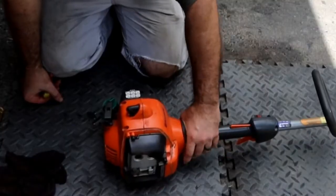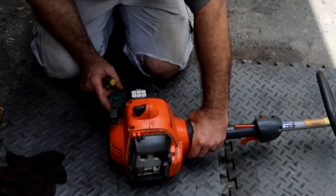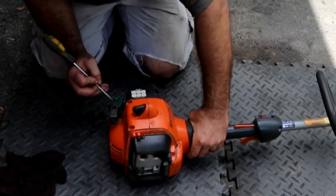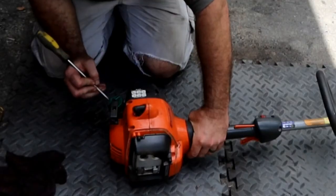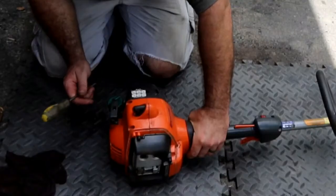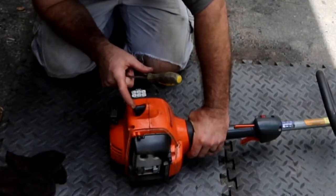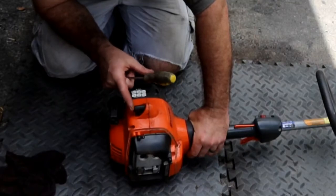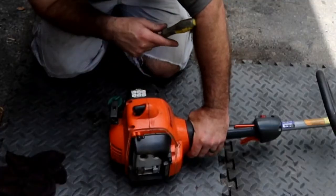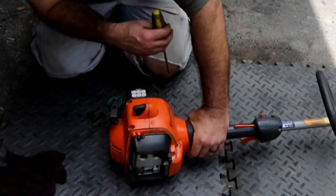Beyond that, a few things can happen. If it was a vacuum issue, so if the breather that I believe on this one's inside the cap was plugged, which this one's pretty dirty, if that was causing a vapor lock, that would have settled while it cooled down. If the spark plug was bad, it could have repaired itself as cooling down, right? So if it's breaking down under heat, the coil itself could also do the exact same thing. Anything else that would have caused that,